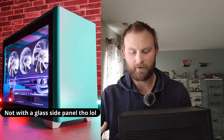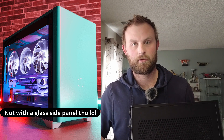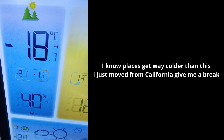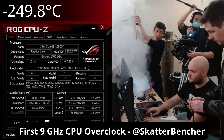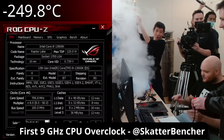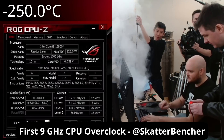This might be okay if you have the GPU in the vertical configuration where it's pulling air in from the side rather than the bottom, but I couldn't do that because I had a 280mm radiator and the vertical GPU mount does not fit when you have a radiator that large. Even living somewhere that sometimes gets to minus 21 Celsius, I still think PCs should run cool and quiet — especially if you plan on using Ryzen 7000 or anything Intel, both of which run a heck of a lot hotter than this 3700X.